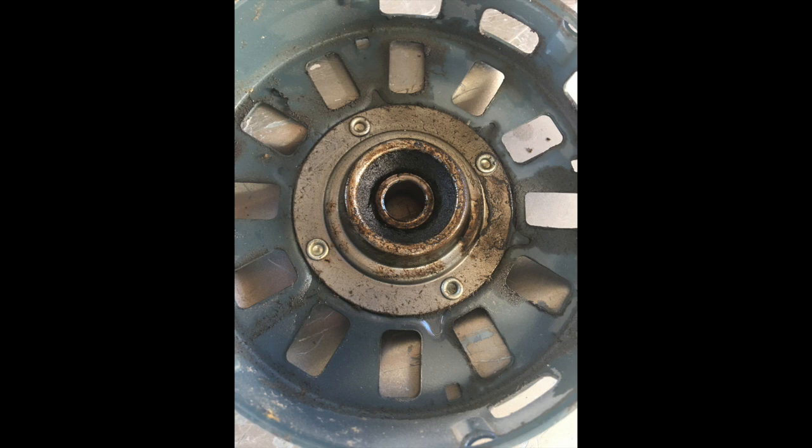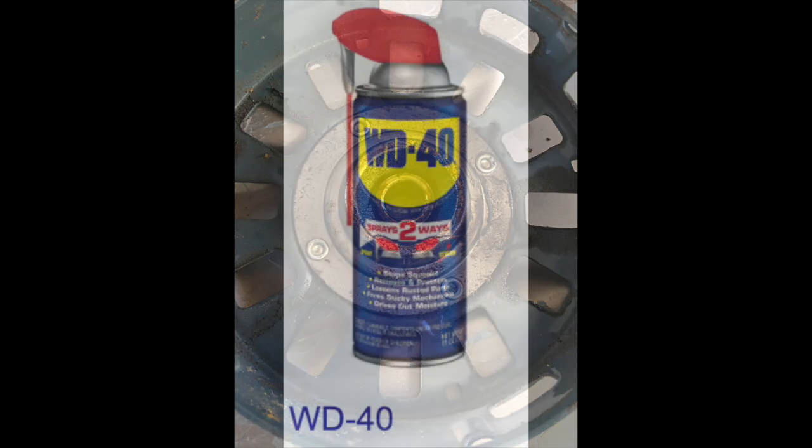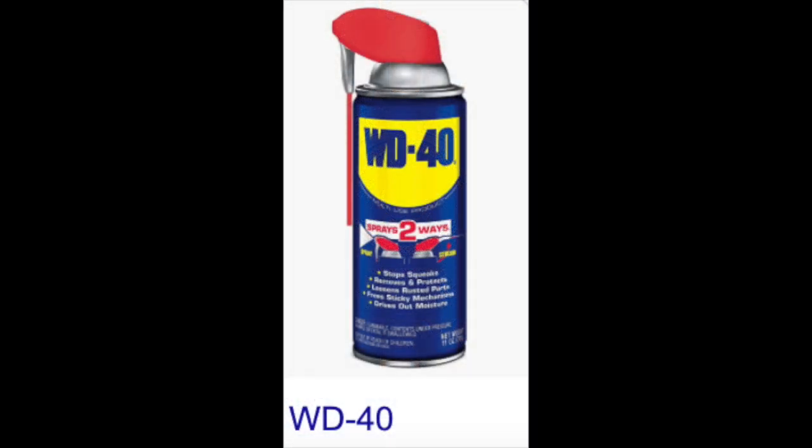Your bearings might be completely dry, which will require more oil than what I used for this particular motor. Go slow and make sure you are not putting in too much oil. Allow time for the oil to soak evenly into the Permawick before deciding you need to add more. Do not use solvents like WD-40 to re-oil these bearings — very important.